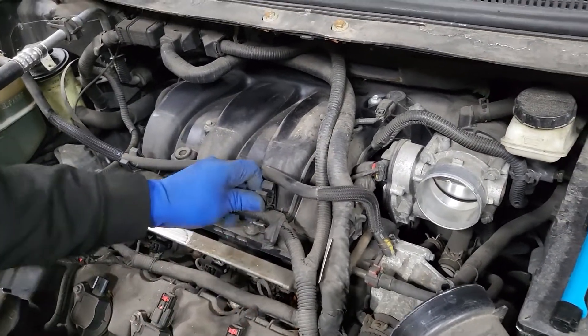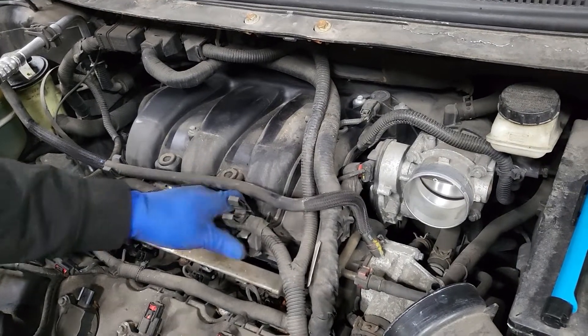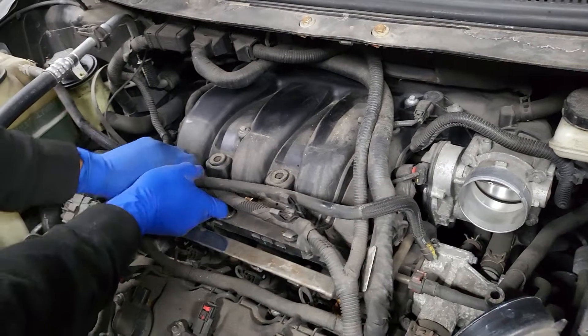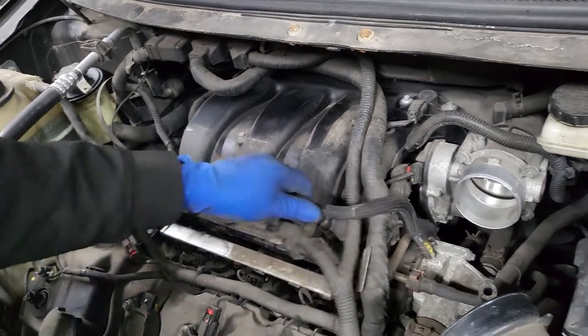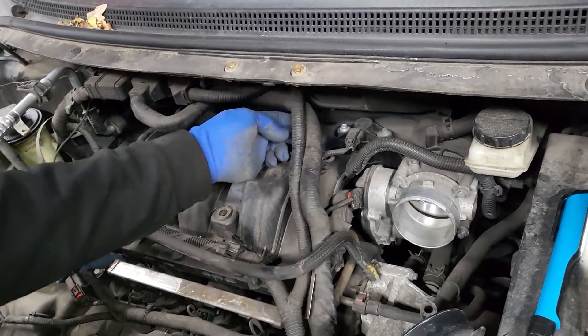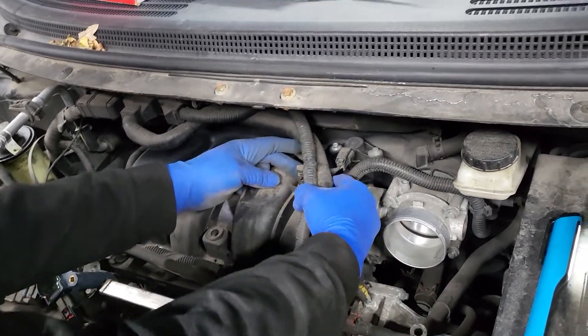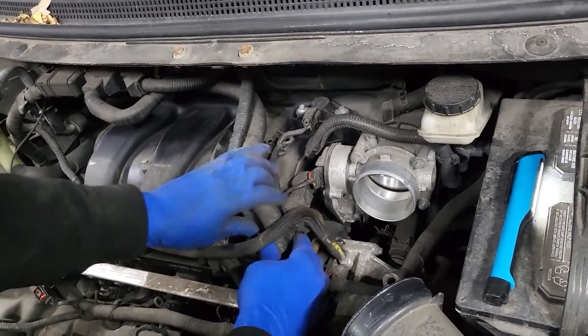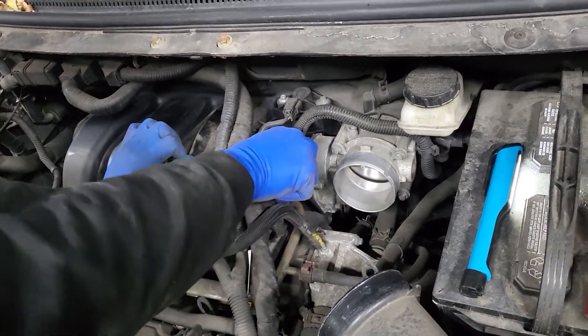In order to take the coils, here's what you need to do: disconnect all these hoses. I'll give you the idea of how to reach those coils. I prefer that you put three new coils in the back, because there is no reason to take all this apart and only replace one coil.